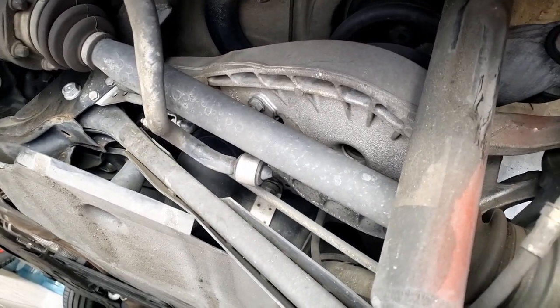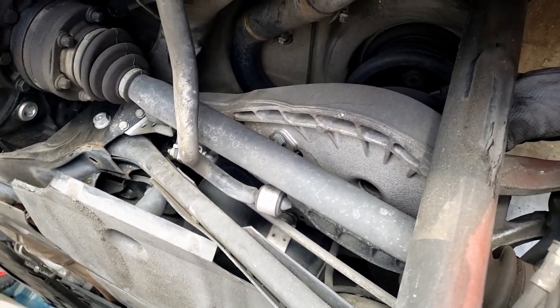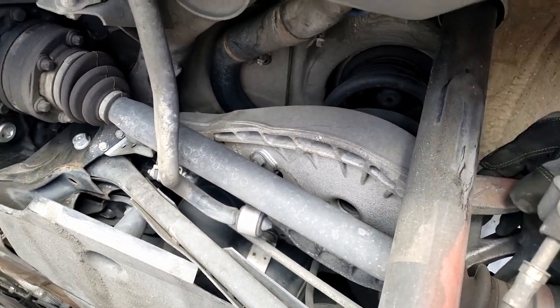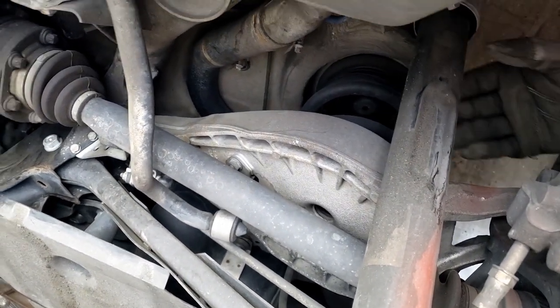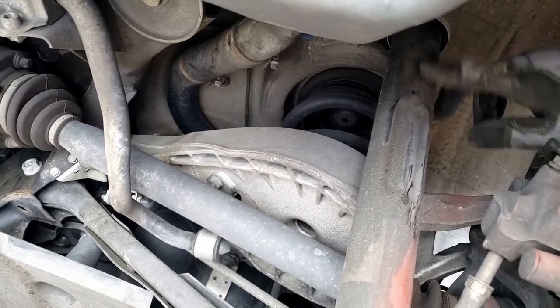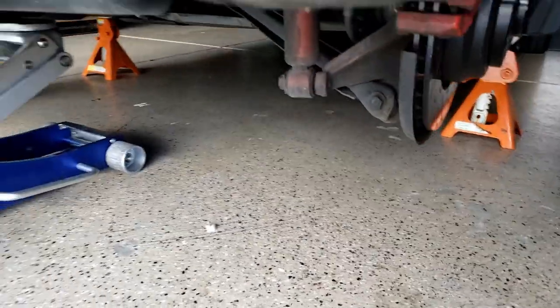That's all I saw on YouTube. They did a pretty good job. It looks pretty simple. It's not that hard, you just need to work with it to get it out. Then when you get the spring out, you go up to the trunk and unbolt these two things, maybe 13 millimeter on top, to take out the shock. That's it. Just put it back in the reverse process.